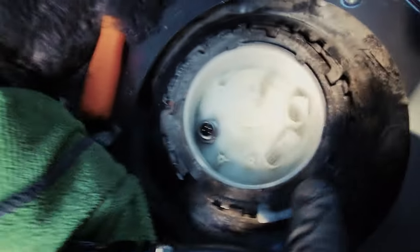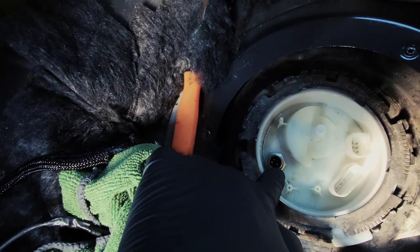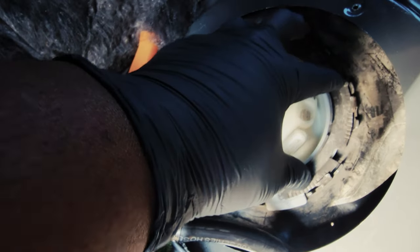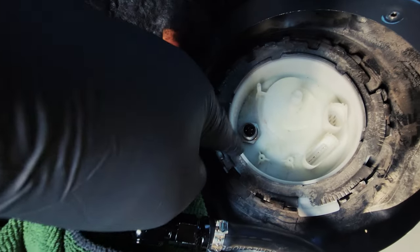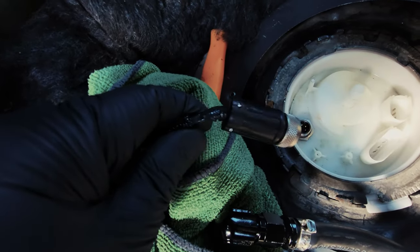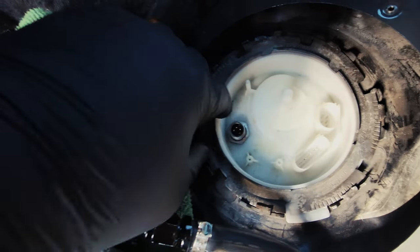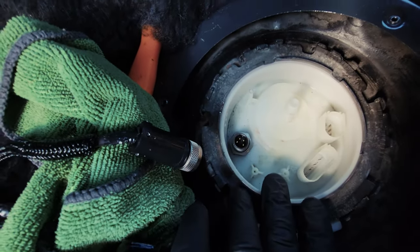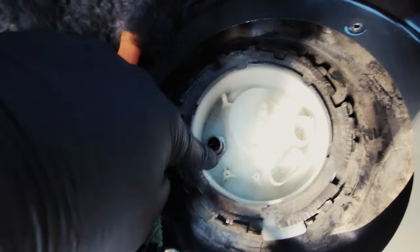I've taken the fuel line off, the clips off, and the secondary fuel pump connection off. This part needs to be drilled into the stock top hat of the fuel pump — specifically into the top of the fuel filter portion. You just drill the correct hole. It's a threaded connection and sealed, so there should be no fuel leak. Make sure you use the right gaskets and install it as shown here. Pause the video and take a screenshot.